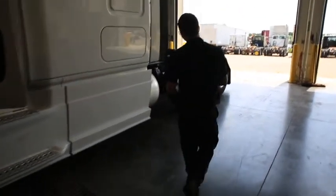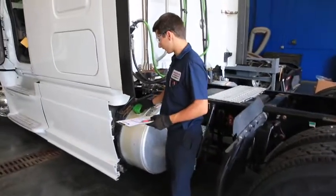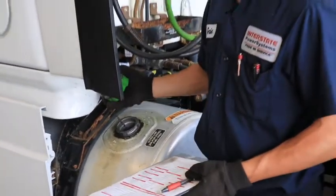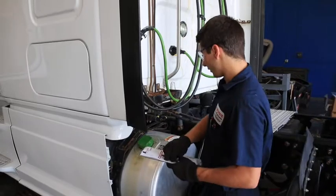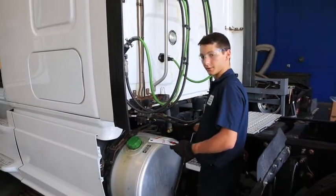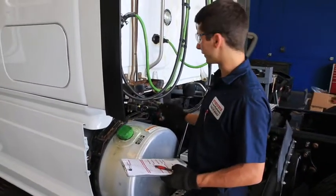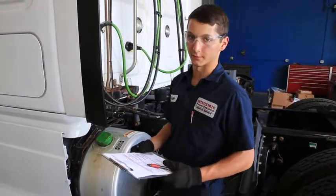Working our way around the truck — this truck has dual fuel tanks so we'll check this side first. Make sure the fuel cap is present and tight. Remove it to verify the seal is still there and the locking chain is present so it does not get removed. Check the fuel tank straps where they connect to the frame rail with no loose hardware or shiny threads indicating looseness. Underneath the truck, there'll be a few fuel lines — a return and a feed — make sure there's no fuel leaking, and check around the tank straps for any rust.